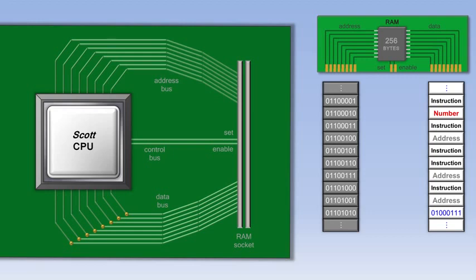These addresses can be used for various things. For instance, if you want to output a number to an external device, you have to know the address of that particular device — do you want to send data to the printer, or do you want to send it to the monitor? There are also letters stored in RAM. If you want to show some text on the screen, you would actually store it as a bunch of 1s and 0s in RAM. Each letter is stored as a particular combination of 1s and 0s according to a character code. These character codes are arbitrary — someone just decided that this is a lowercase a, and this is an uppercase G, for instance. So that's what's actually in the data inside RAM.